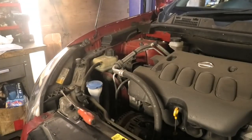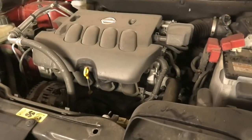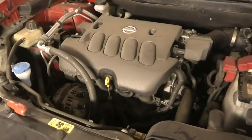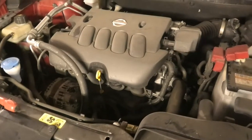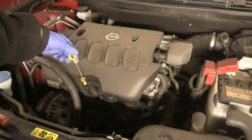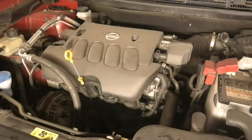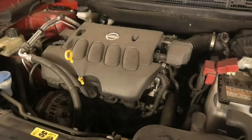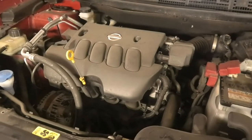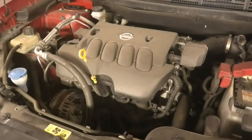So we can go ahead and close that up. Now I'm going to concentrate on the oil and the oil filter. I'm going to get the car up and drain the oil from underneath and tackle the filter from underneath as well. But before I get it up, I'm just going to take the dipstick out and also open the oil filler cap and leave them like so. If you're working outside, don't remove the oil filler cap — just leave it loosened so nothing goes in there like dust, leaves, or anything else. Let's get the car up and tackle things from underneath.